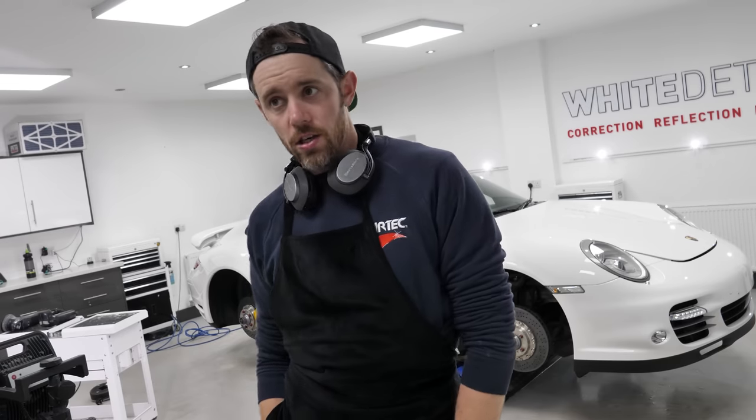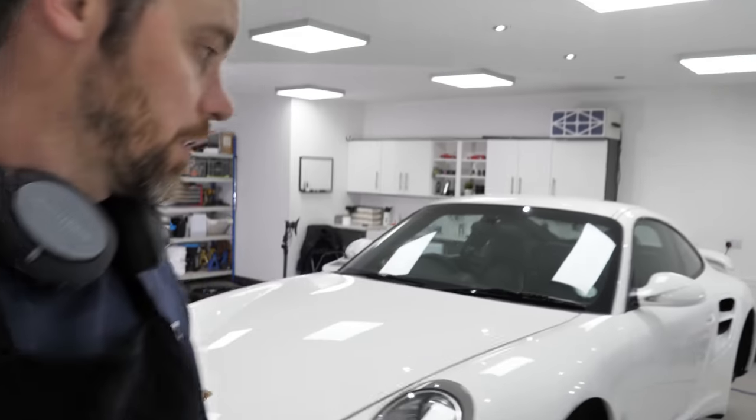And as I said at the top of this episode, this is a clean car and it's actually very difficult to photograph or video the defects. So usually on a regular vlog, I pick up the camera, sort of assess the whole thing. But what I think I will do is just crack on, get some vulnerable areas taped up, the window trim around the A-frame there, various sections, start some corrections, see how the paint responds, then come back to you with the camera. And also, it's not the thickest of paint systems. I've got some readings on the lower portions in the 80s, 90 microns. That may mean I adjust my system, my approach.